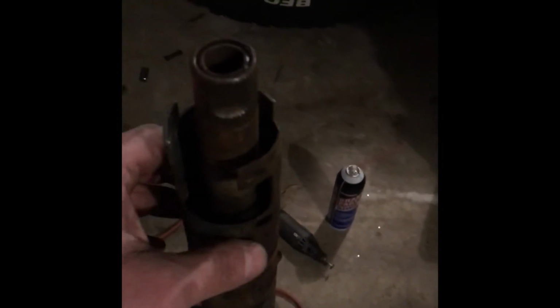And yeah, so I'm going to go back and put that Loctite on the set screws, which are little brass tip set screws right here. Put some Loctite on them, get them flush to the inner diameter of the bearing, and then put some petroleum jelly around the surface right here to reinstall. So that's the next step.